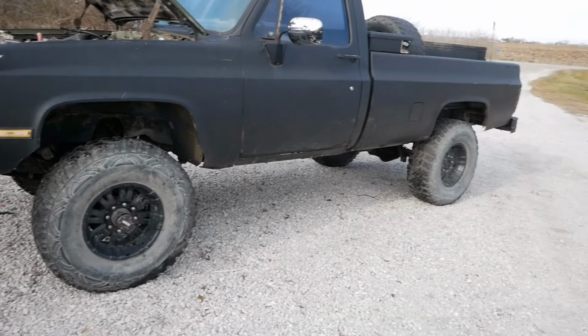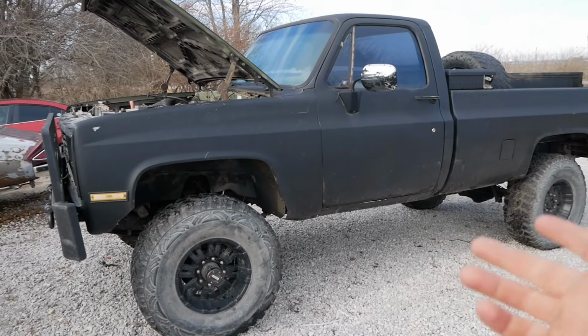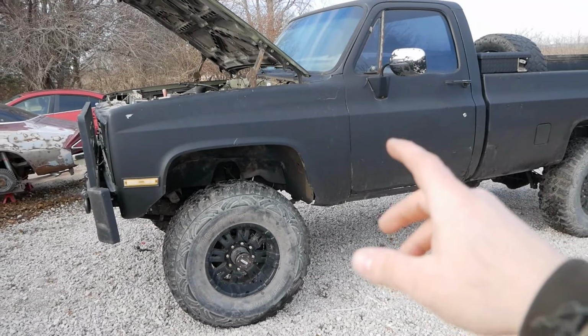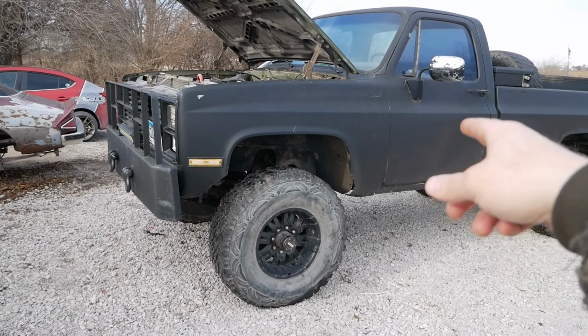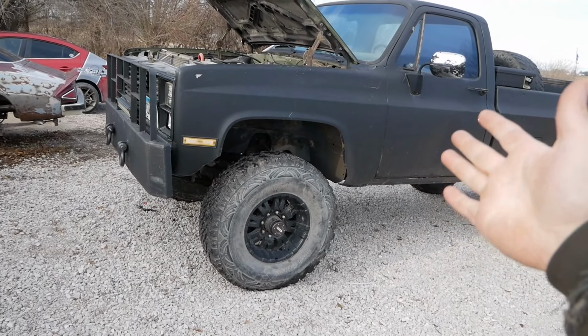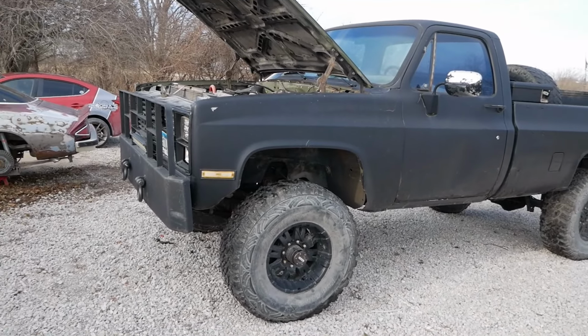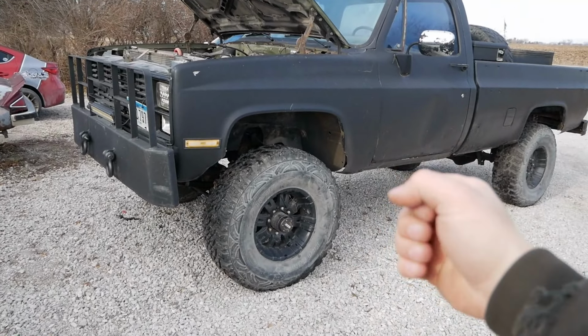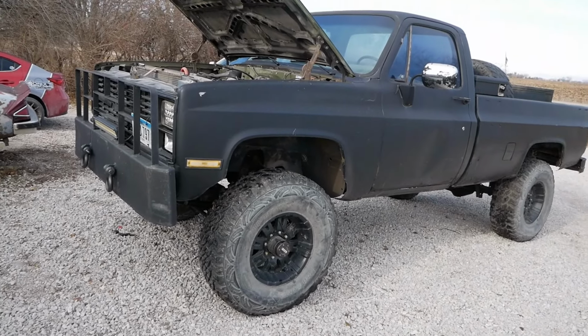It kind of moves around the property, but there's a lot of things like the taillights that don't work. The fans need hooked up to relays. This has got a lockup torque converter, so we have to get the switches operating on the full manual valve body because I have to shift this manually, even though it's an automatic. There is no just putting it in drive and having it start in first gear shift automatically. I have to do that for this now.